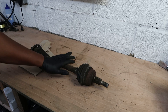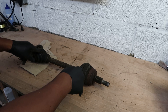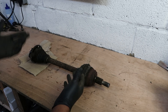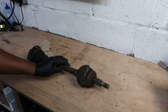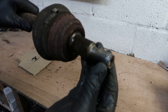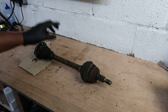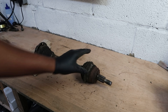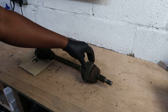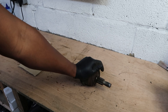If you don't know what this is, you should - this is a drive shaft. These don't really fail much, apart from these rubber gaiters, called CV joint gaiters. Easy replacement - pull them off, put them back on. That's the only thing to really worry about. They're pretty good otherwise, full of ball bearings. These are not really a super hazard, but it is an MOT or inspection failure. When these break, it'll be greasy around here - you'll see grease start to ooze out. Apart from that, really simple, easy, and non-problematic.